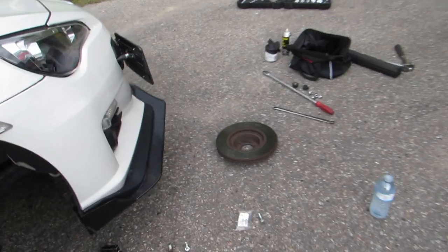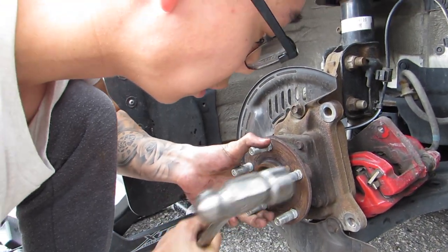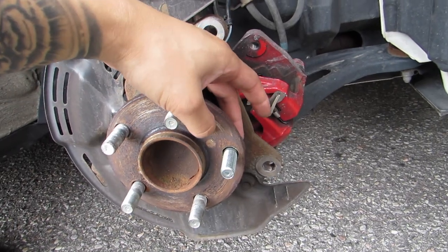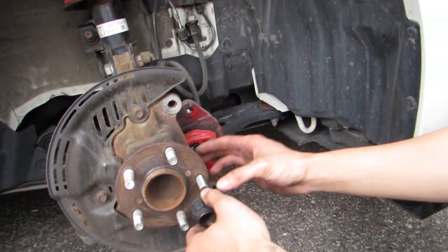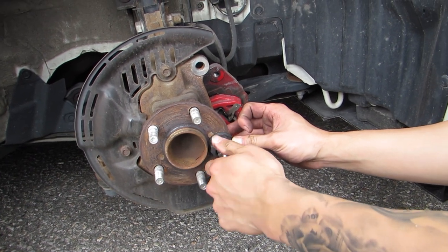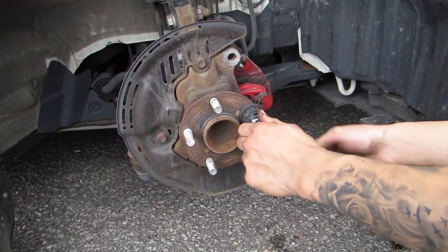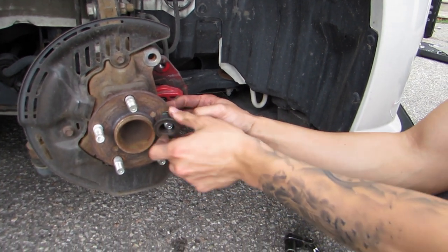The rotor came off. He did that in like five seconds — you guys saw he just hammered it right out. This is the stock OEM one from Subaru that I picked up. When you do this it's pulling it inwards and then it gets tight, basically seating the lug. When you turn the lug it's pushing it in. I would have just hammered it from the other way — it's not wrong, you could do that, but as long as it goes through it's okay.